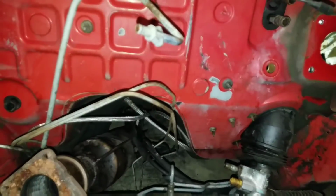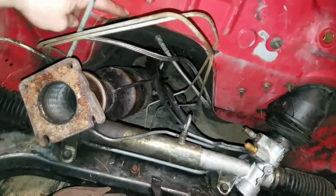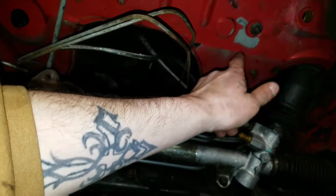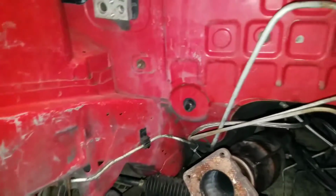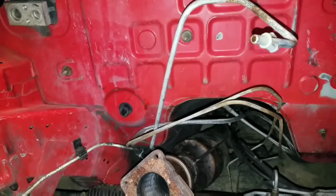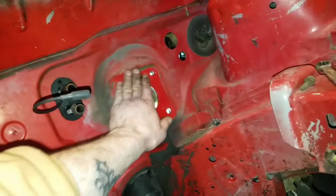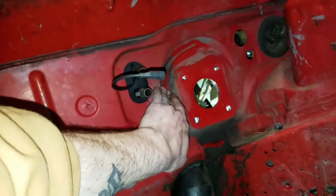We got to remove this fuel line, tuck these brake lines. I think we're gonna run the brake lines, if not up through here, then real close to the tunnel. It looks like a train tunnel, but it's not. It's just a tunnel, exhaust tunnel. Run across real low, and then up into the booster. We'll figure that out when that day comes. But yeah, that way we don't have to worry about any heating issue on the brake lines. But we gotta clean all this off so we can get it primered at least. Primer would be nice.